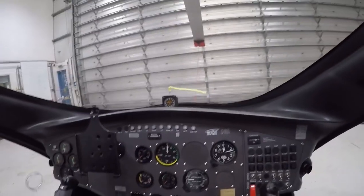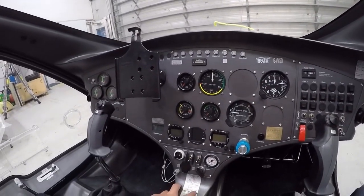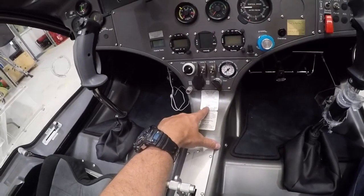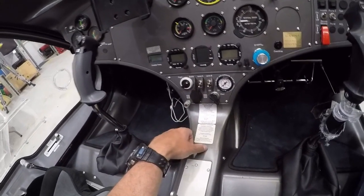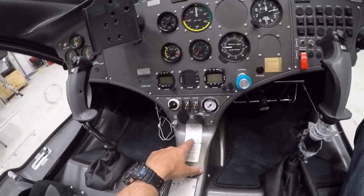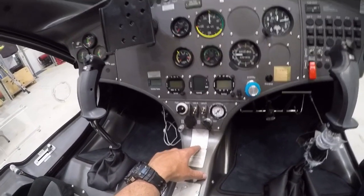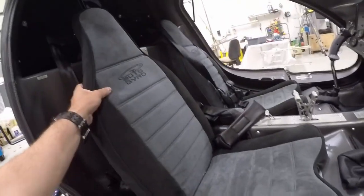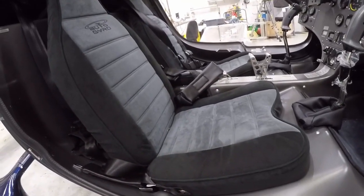Inside there's also a compass on top of the dashboard and a yaw string stuck to the windscreen, as per most light helicopters. Maximum all-up weight is 560 kg — better than the M24's 500 kg — but the empty weight is 340 kg. The Cavalon takes 100 litres of fuel, and at 72 kg that doesn't leave a lot of headroom to max all-up weight. I think a lot of people flying these 915 Cavalons will have to be careful not to fly illegally. It probably also explains the relatively low spec seats, with leather, lumbar, and seat heating likely deleted to try and keep the empty weight down.